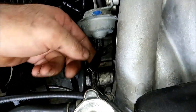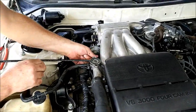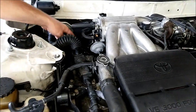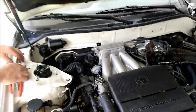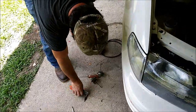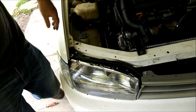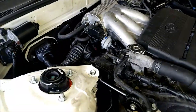You've got to check that. I know some of you have disabled this device — I don't know if it's helping your fuel economy, hurting it, or raising your horsepower. But if this is the way Toyota came factory, they did it for a reason — they wanted to build this engine with as much performance as they could get out of it. At the junkyard, we didn't tell them what it was because they had no idea. We told them it was a vacuum actuator, because that's what it is — it could be for a carburetor, a choke system, or any old carbureted engine.